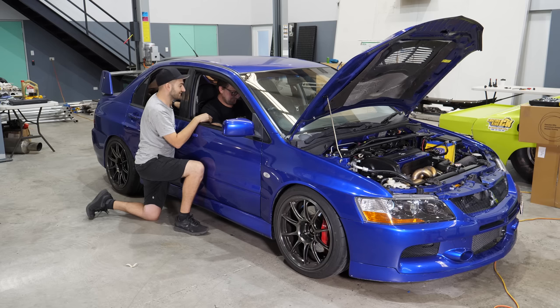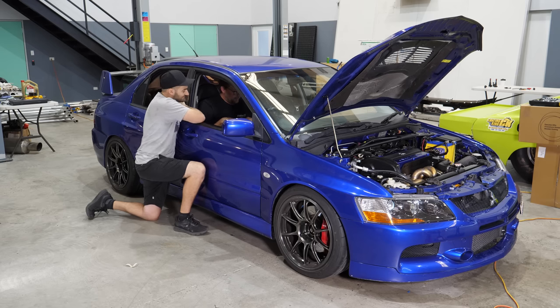Come on. Almost got there. Right. Didn't quite clear up, did it? It didn't have enough fuel. So you could tell that? I could hear it, and the wideband was displaying huge numbers. Super lean, like in the 20s. I'm just going to go through and artificially add a heap of fuel just to make sure that it's going to go.